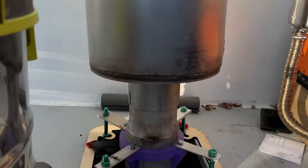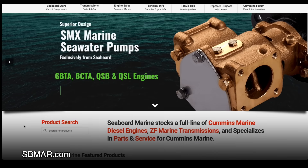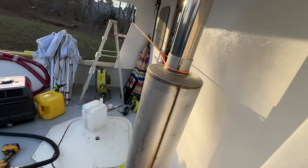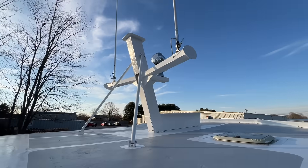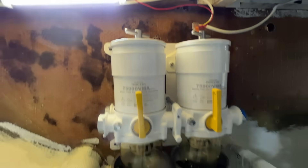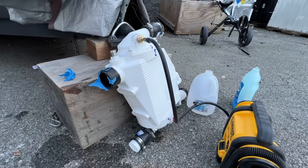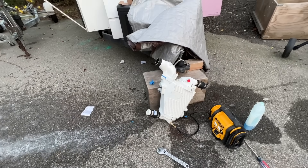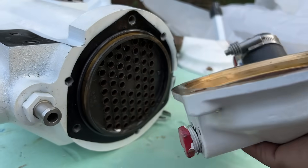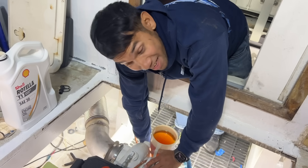These exhaust parts come from Seaboard Marine. They design and do all sorts of custom fabrication. If you've got any sort of boat project with a Cummins engine or if you need a ZF transmission, these guys are definitely the experts. Time to install the Racor fuel filter — this is only a couple thousand dollars. It's very important that I don't have contaminated diesel fuel going to my motor. This is the engine after-cooler — it cools the turbocharged air and mixes it through a heat exchanger with seawater. I'm going to pressure test this real fast to make sure it doesn't corrode or have any leaks, then lube it up with some metal lube so it's easy to take apart in the future. And then we put oil in the motor.